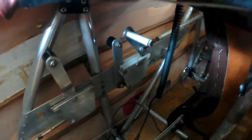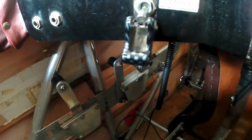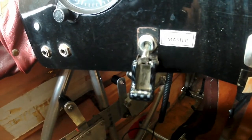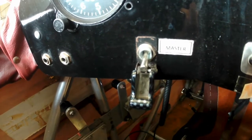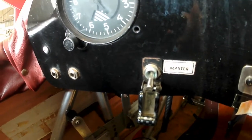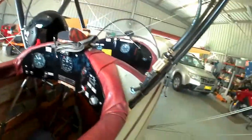The little one in the middle is for choke and the throttle at the front. There's no mixture — the mixture's done with the constant velocity carburettors and it looks after itself. I've had the aeroplane to — well yesterday I was at 7,000 feet but I've had it up to 8,500 feet, which is completely unnecessary because Australia's as flat as a tack and you can fly anywhere at like 1,600 feet and not hit anything. So yeah, that was just for my own entertainment.